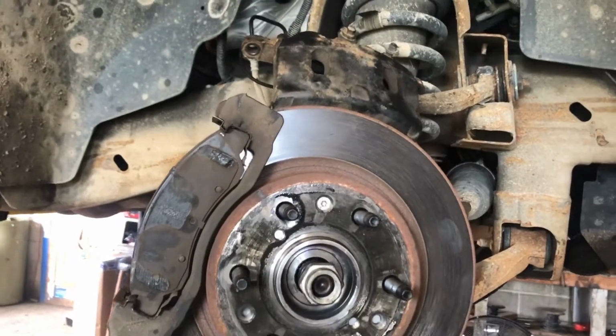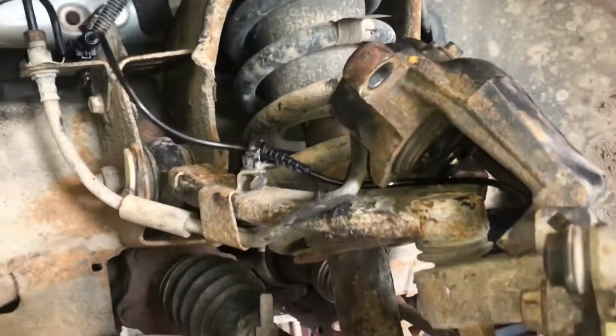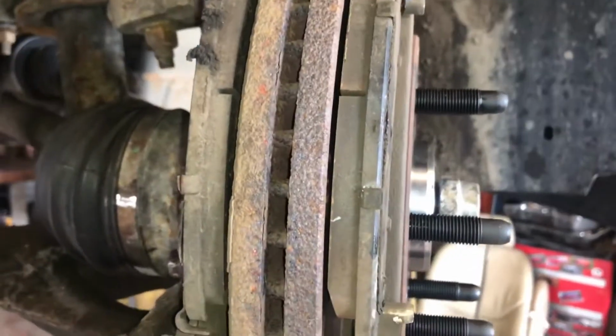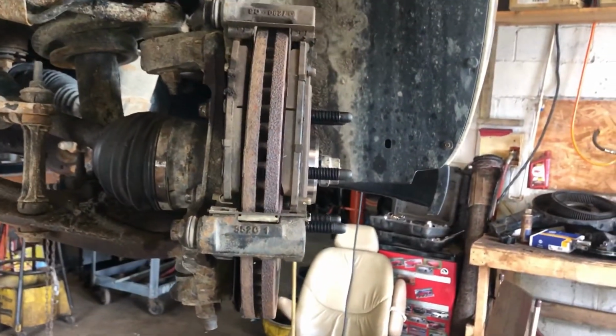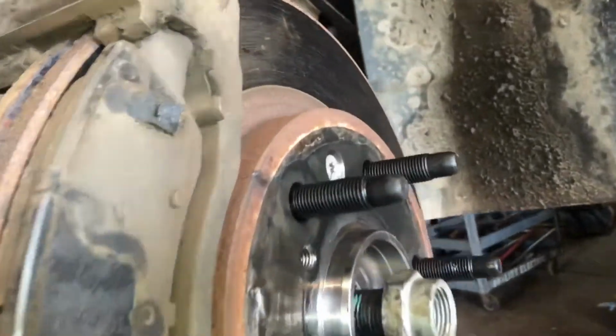And put the tire back on with the 7/8. And we should be good to go. If you had any ABS codes, clear them out. Might've had some with this bearing, it was really bad, wobbling around, really bad. All right. That should do it.